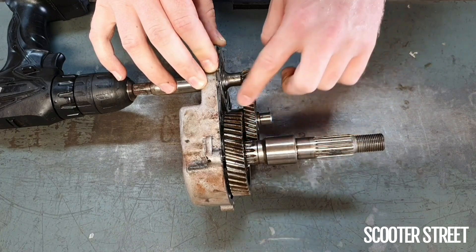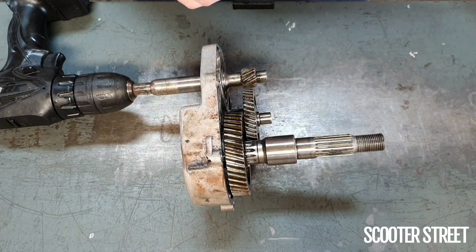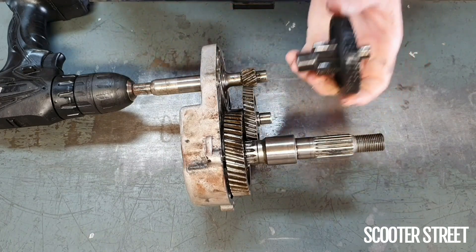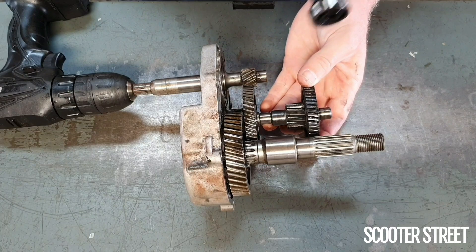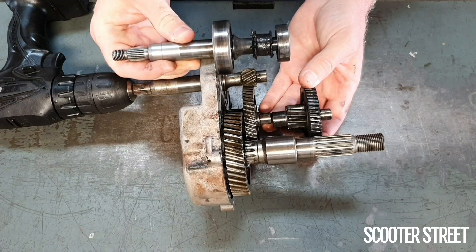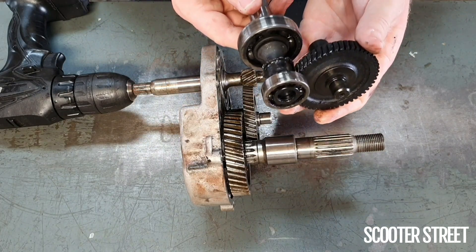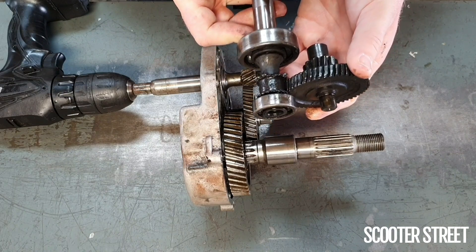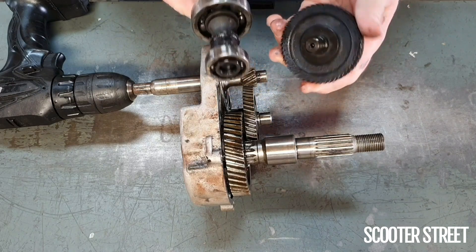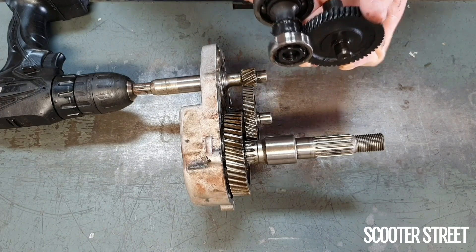If you don't regularly change your gear oil, these gears get really quite hot really quickly. We actually have an example here of one that came into the shop yesterday — it's also off a TGB. You'll be able to see these gears here. This gear here, I think they call it the idler gear, sits between the two main gears. This scooter ran out of gear oil and was running with none. You'll see it's completely stripped the living daylights out of it — that's a very, very dead gearbox. Very crunchy.